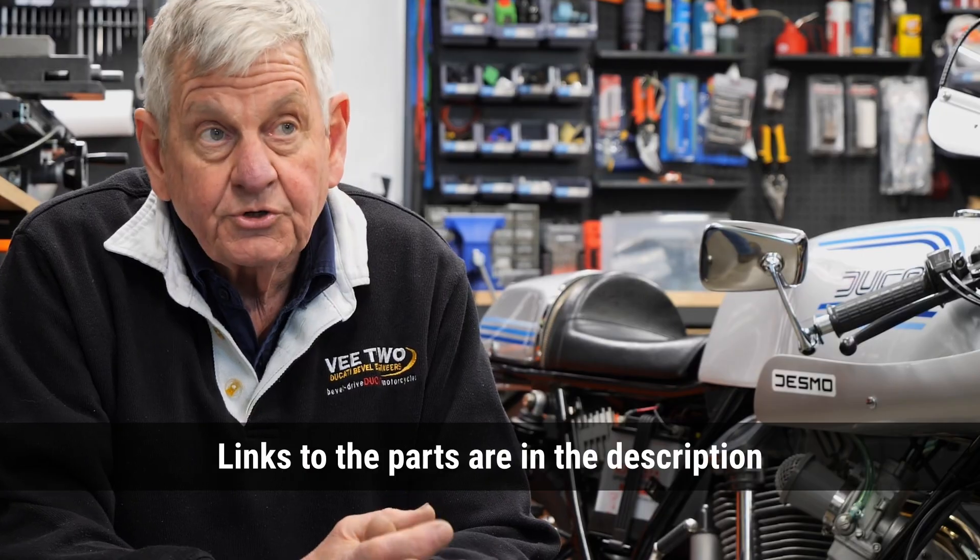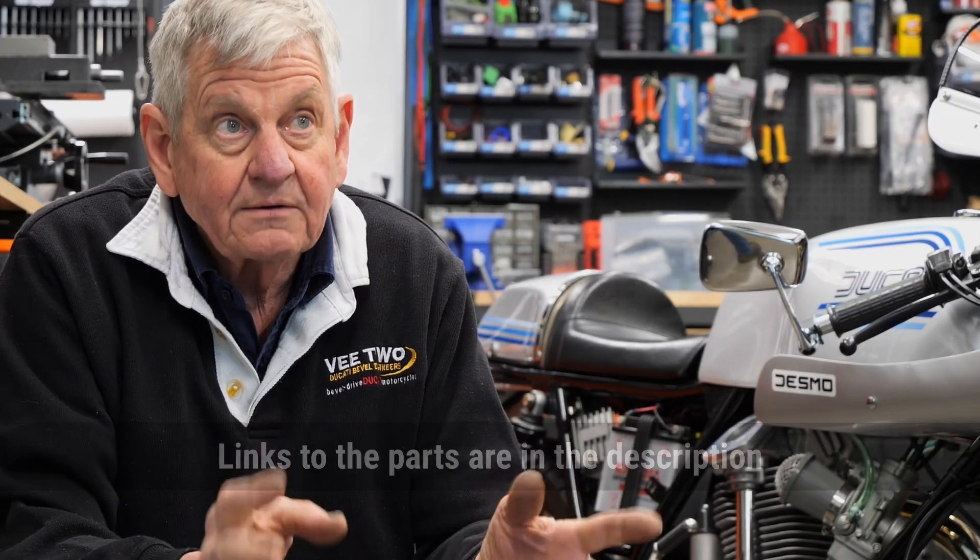On a normal bike, even if it's got an insert in it, the plastic screen that is supplied can still get its way around the end. The screen is not that good, it can get splits in it and all sorts of things. So I've made this thing and I've got them for Round Case and Square Case in stock. I haven't finished the instructions for them, but they're nearly done. They are ready to ship and we've shipped a lot of them. It's a simple way of making sure 100% of the oil that goes into that oil pump is going through a filter or a screen. It's on our website.